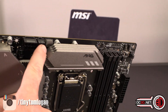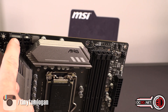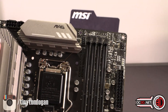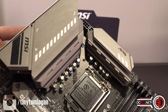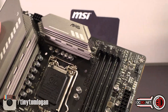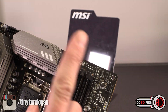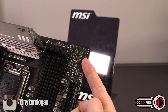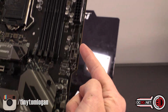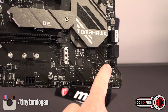Eight pin plus four pin for the CPU is available at the top, and eight should be more than you'd need for most — unless you're thinking about going i9 from either 10th or 11th gen, but then you might run into VRM temp issues. Without testing it we won't know. You have a CPU fan header here, a pump fan header here, and there are no more fan headers until you get down to the bottom of the board.